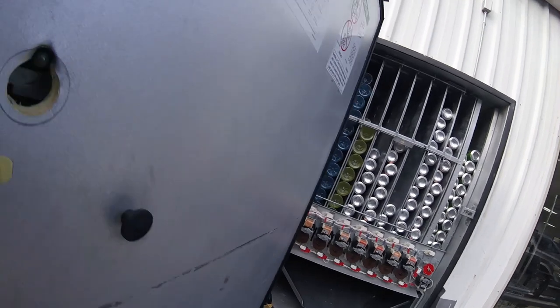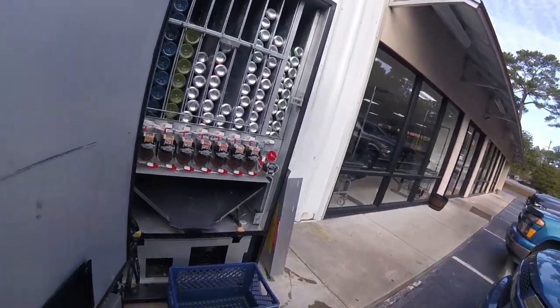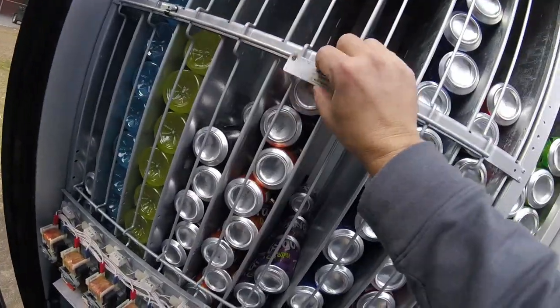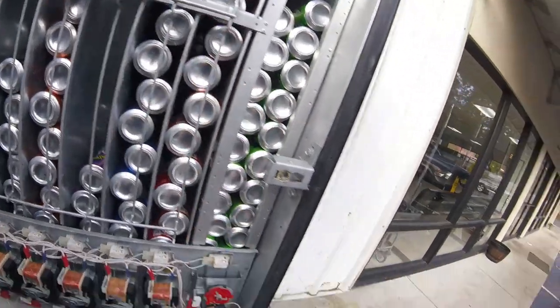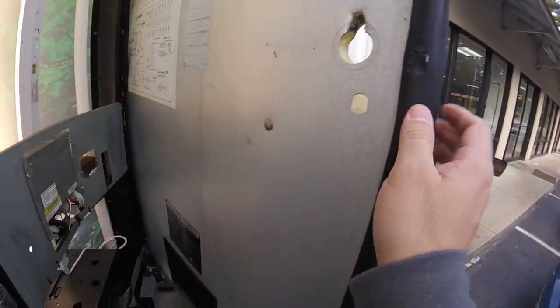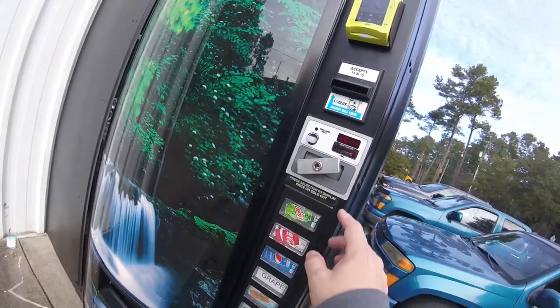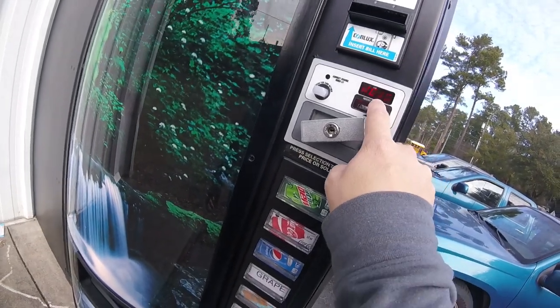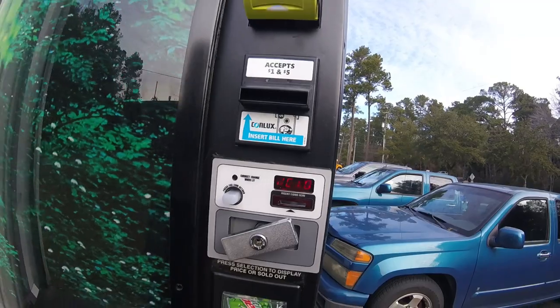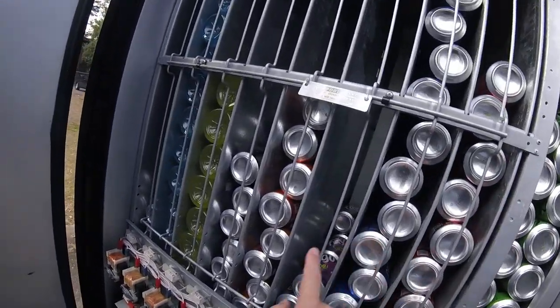There's no column 10 to home, so that doesn't make any sense to me. Column 9 looks okay — nothing seems out of place there. I'm going to hit the door switch and it should home any other issues, but again there's no column 10 to home. If you know what's going on with JC10 on a Dixie Narco 501e with nine columns, put it down in the comments. Also if you've seen the PB10 error and know what that might be, let me know.